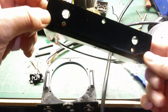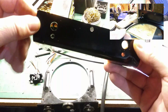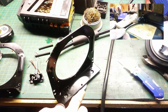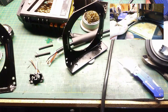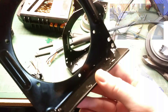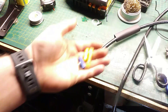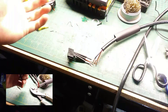I made a few modifications — and to be quite honest, I really didn't have to make that many. Basically, I put some holes in the bottom so that I can mount the magnets, and I scattered them just a little bit to give a little more surface area on the bottom. When we stick this to the top of a car, pulling one back and one forward gives a little more twisting leverage so the wind won't blow it over. I also drilled two holes side by side on the bracket — this is going to be the rear right light — so that I could zip tie my cable to the bracket. When you're tugging and pulling on the cable, it's not going to pull on the plug itself. For terminating the wires, you could use butt connectors, but I'm going to solder them and put some heat shrink on it for a little extra protection.